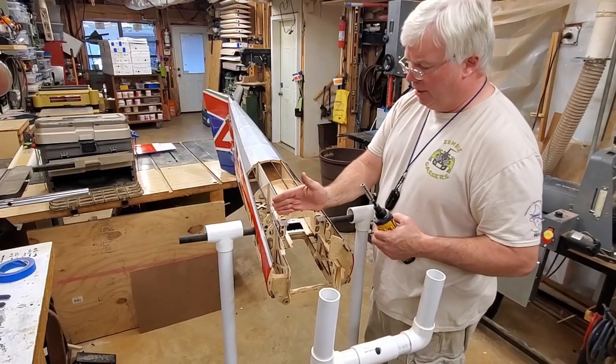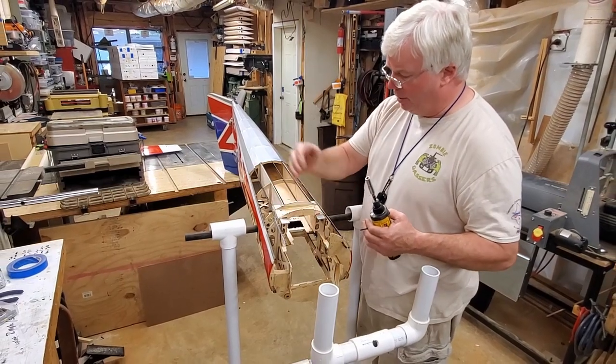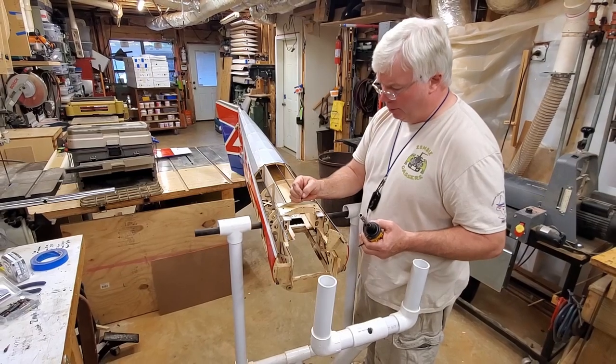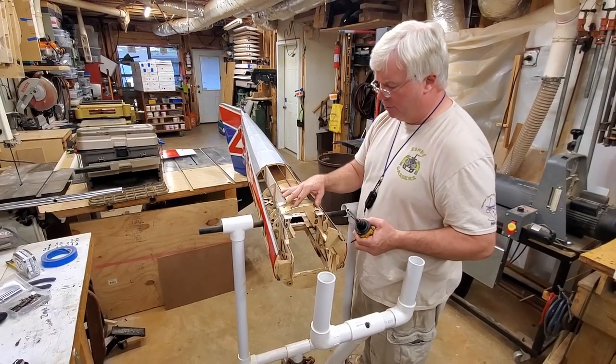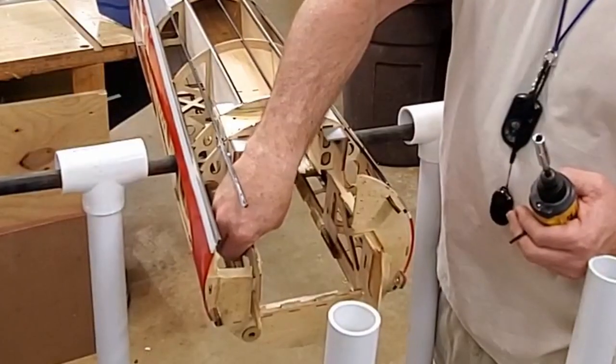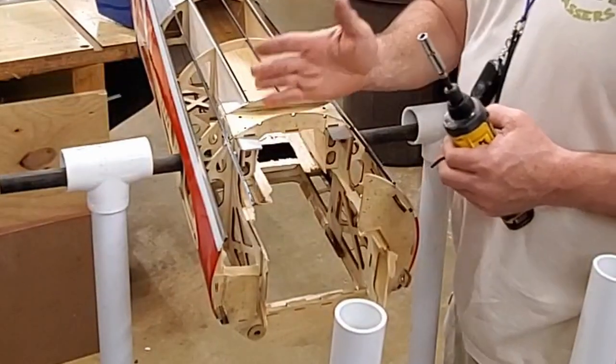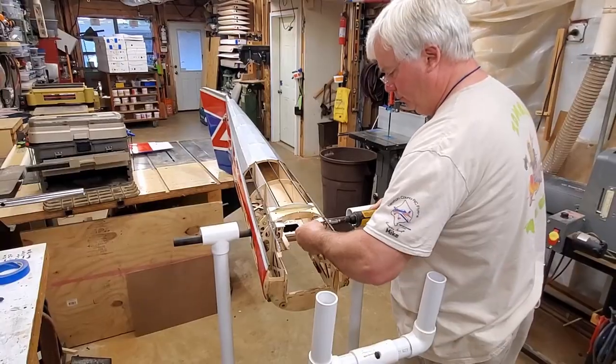I'm going to go ahead and pull this landing gear plate out, get all of this out of the way, and we'll just rebuild that. It'll be a lot cleaner and a simpler repair anyway, rather than having to build around the structure that's already here. There are a few stress fractures there in the main truck system, so let's go ahead and get that out of the way and see what we have.